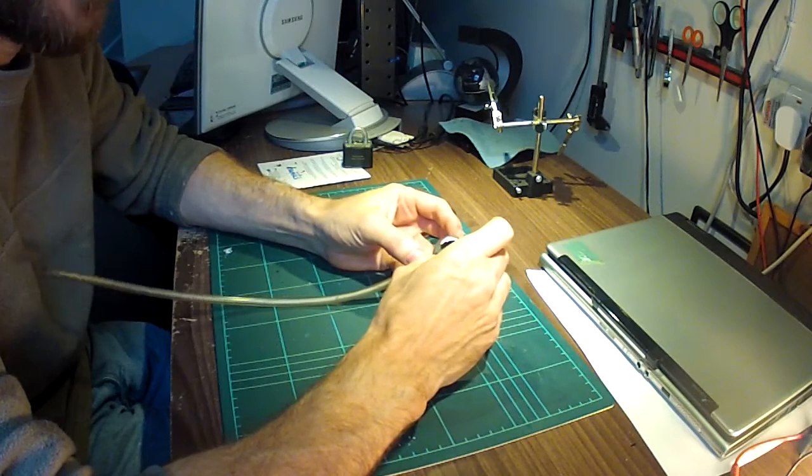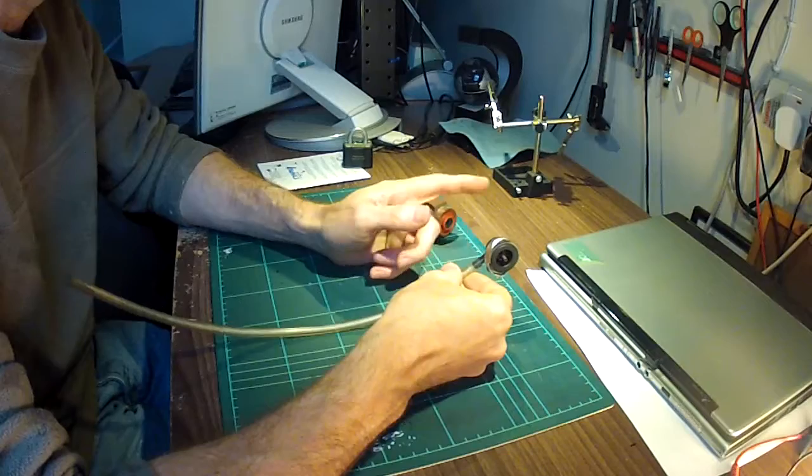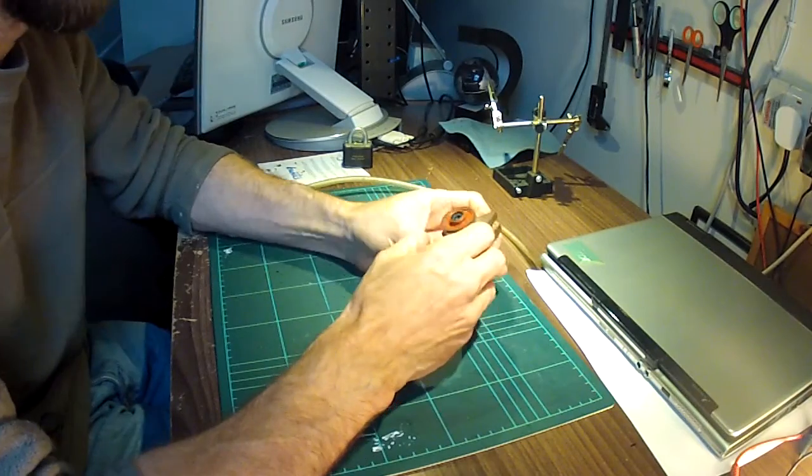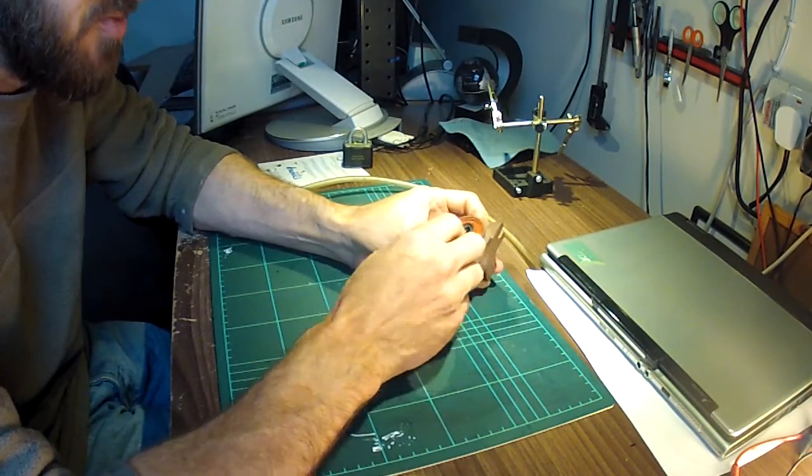The vacuum is drawn out of this middle pipe, goes through this chamber here, and is then sucked up to the turbo. When the wastegate is open, this pipe is blocked off. When the ECU wants to spin up the turbo, it unblocks that pipe so the vacuum carries on through here to the turbo wastegate.